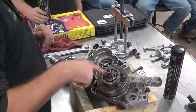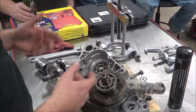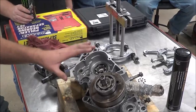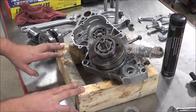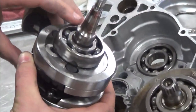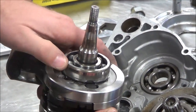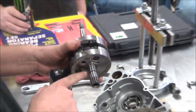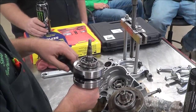We're going to work on taking a bearing off a shaft. This happens to be on a crankshaft, but the technique could be used on anything — an axle or anything else. I want you to think about the order we do things, because it can make life a lot easier. You can see the wooden boxes we use for supporting these cases. Here's an example of a bearing that needs to be pulled off. It would be harder to support the crankshaft and work with it, so the time to take this bearing is better when it's properly supported. I'd take some soft aluminum jaws, clamp this in a vice, and get the piston off so I'm not having to worry about it.